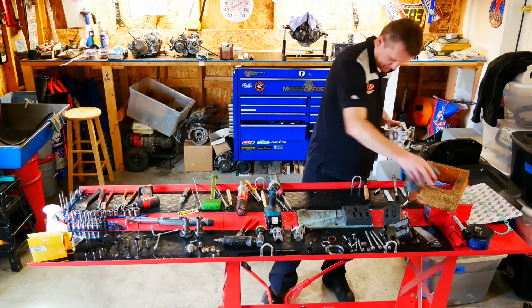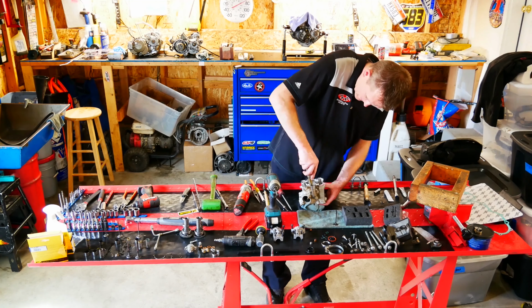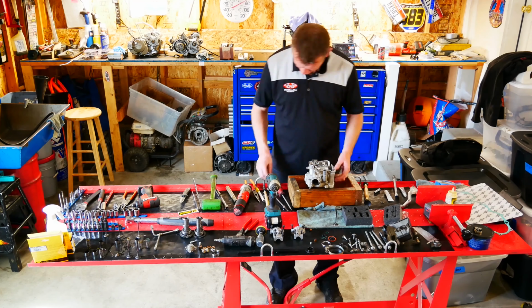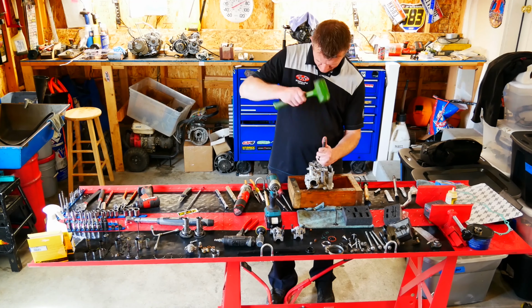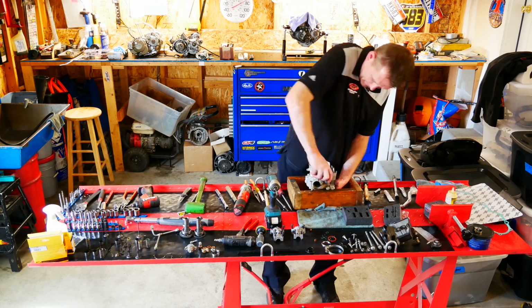Now on two exhaust valves, I'm going to go ahead and use a soft rag, fold it up and put it on my bench. That'll give me enough wiggle room to get those retainer clips in. And once again, I'm going to set it up and take a punch and hit the top of the valve and make sure those retaining clips are set.